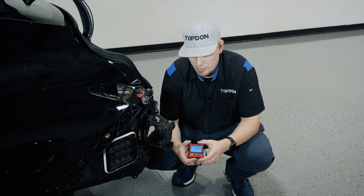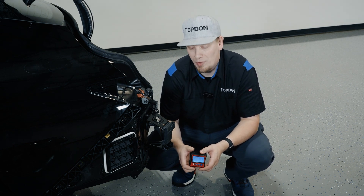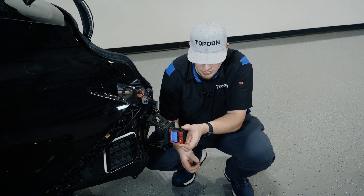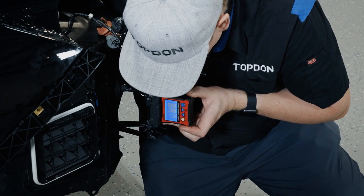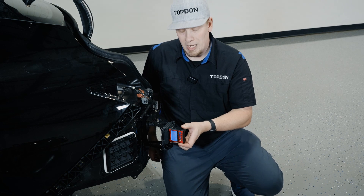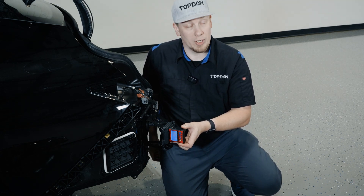The specification on this vehicle is 90 degrees plus or minus 1.5 degrees. So if we rotate our angle inclinometer and stick it centered over the hump, we can read out the angle. Currently it's reading 89.37 degrees, so we are within the degree and a half range of error that is allowed for this particular radar.